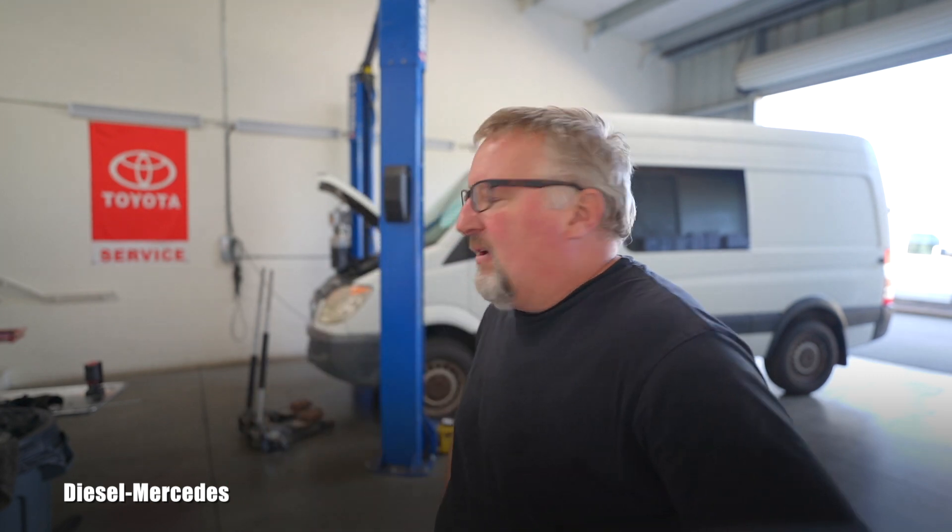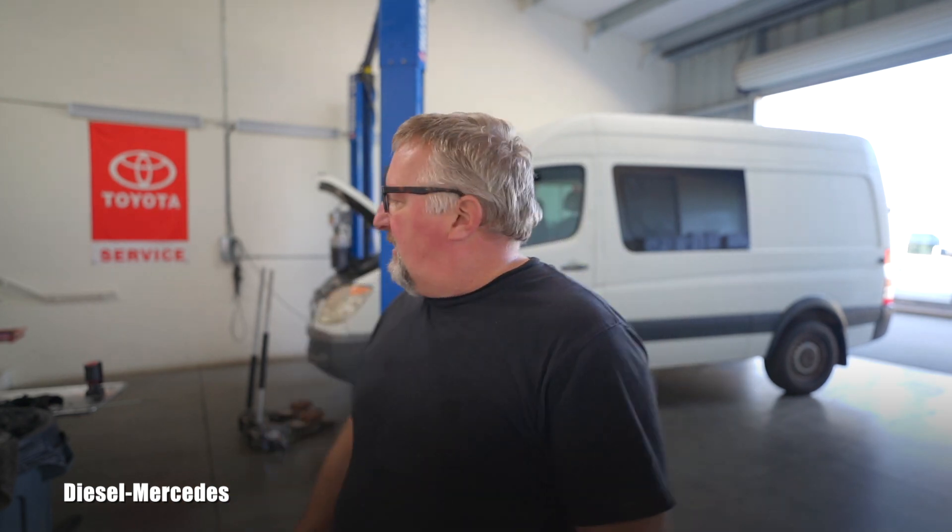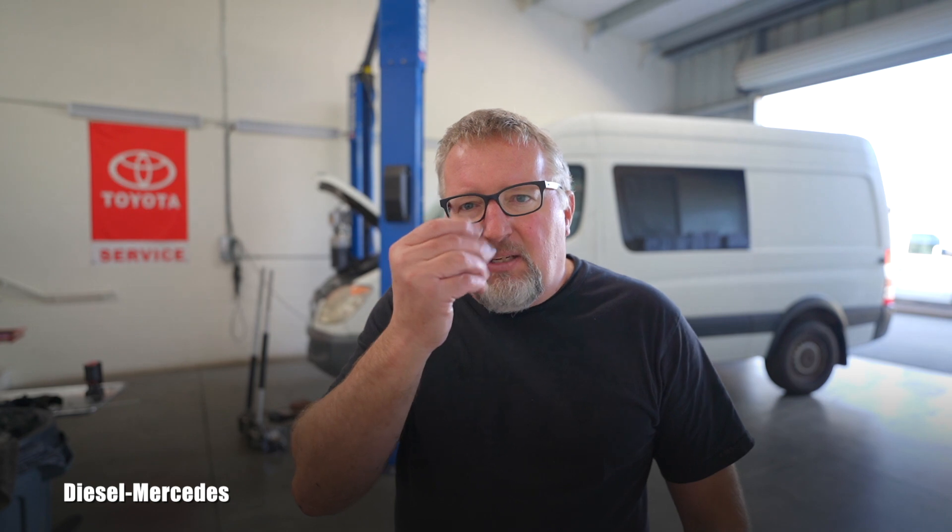That was the technical information for those trying to go all the way. The drain plug is included, which is a big advantage over just draining and refilling the pan — which normally only gets you about 4 quarts out. Now I know I got everything out and I'm starting from scratch. Fingers crossed this transmission is good. It only had miniature shavings, which is fairly normal at 209,000 miles. Thanks for watching, stay subscribed — more coming soon.